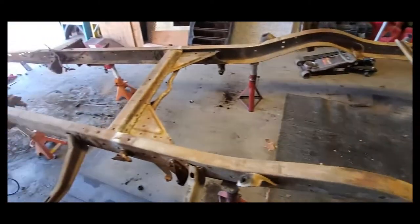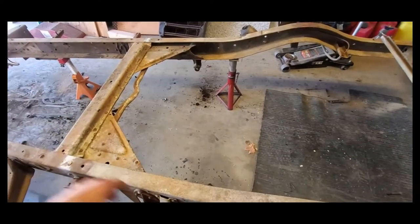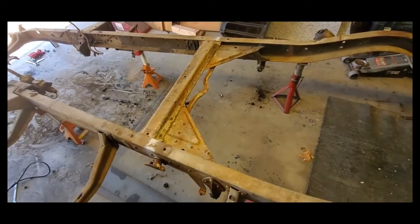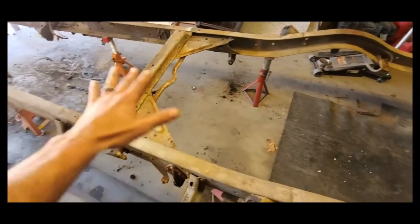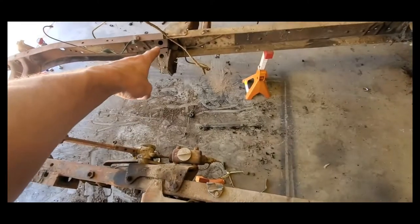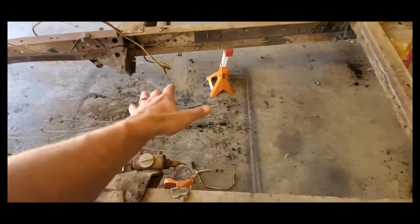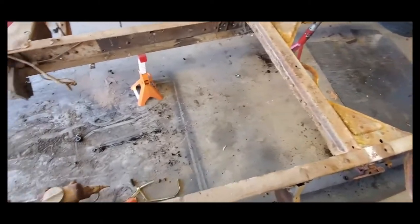So as you can see, everything's actually out. We removed the rear pins off of both sides of the leaf springs, and then just shifted everything forward. The frame itself totals probably 400 to 500 pounds. I could lift it by cantilevering it off the other jacks and we just moved it along. I also ended up cutting out the BS mount between the transmission that they had built, then lifted the transmission up and out, and rolled the whole assembly out.